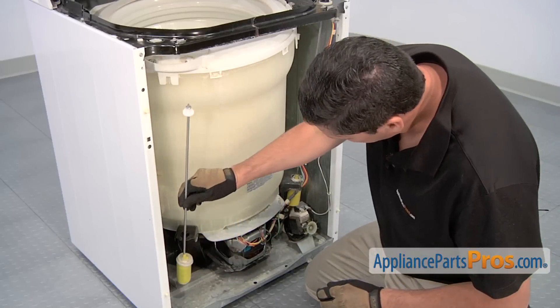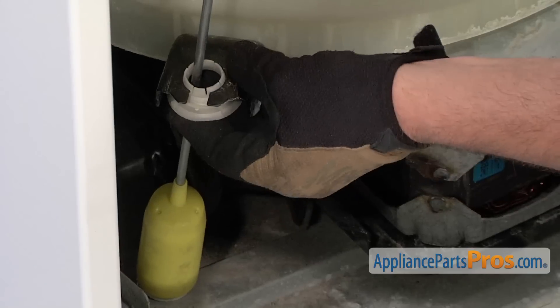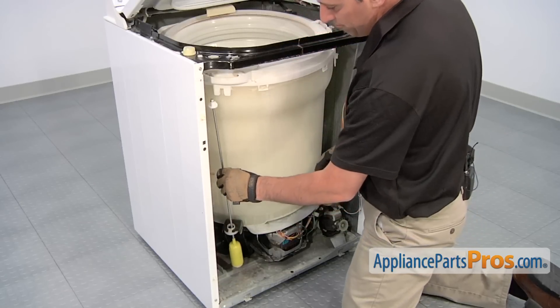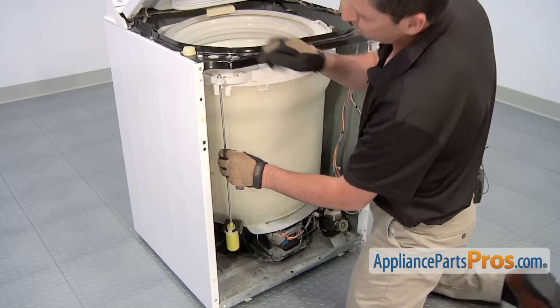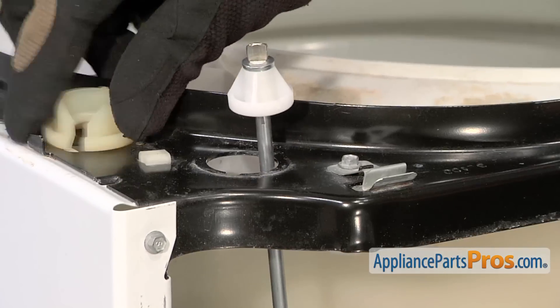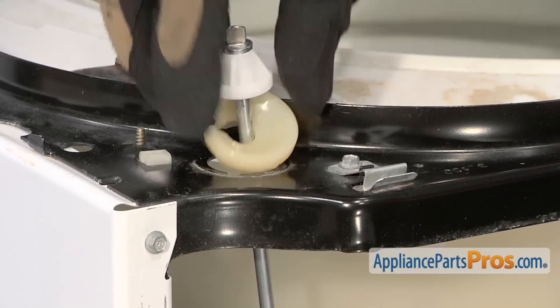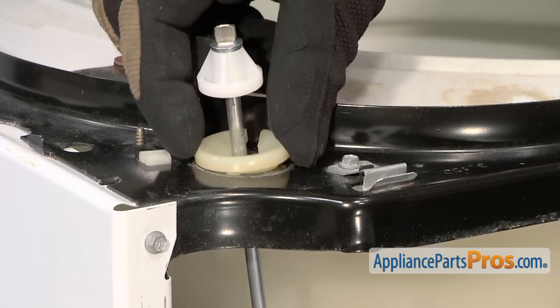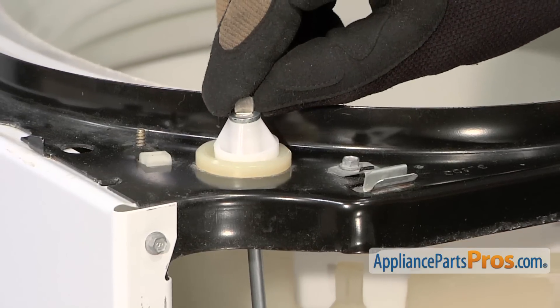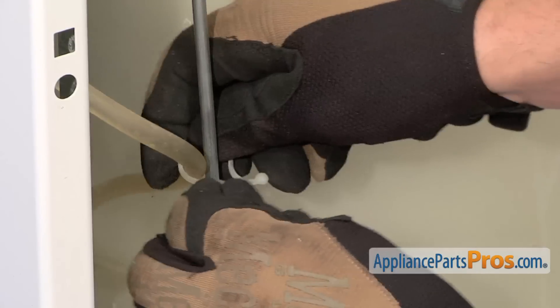Position the new part and then install the plastic mount in the chassis. Position the rod so that this end goes through the hole, so we'll need to pull it up. Install the socket rod support and then rotate the plastic support so it goes down into position and then lower down the rod. Reconnect any wires or hoses that were originally attached to the rod.